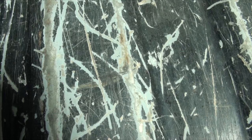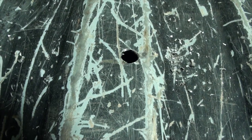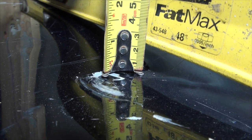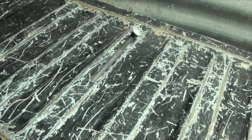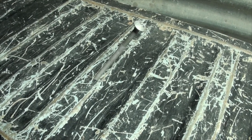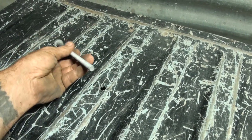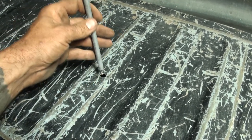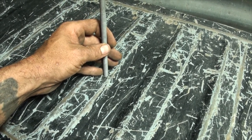This is the back side of the tailgate. You can see how bad a tailgate gets, which is exactly why we don't mind drilling a hole from this side. You won't always be able to access the back side of a dent, but in this case it's the best approach with basic tools. My hole is drilled. We can see the dent is one inch deep at its lowest point - we do not want an inch-thick slab of Bondo. I'm going to use a bolt with a dull end - you want quite a bit of surface area, which makes this better than a pointy punch.